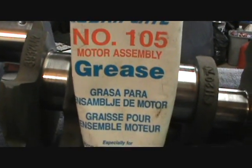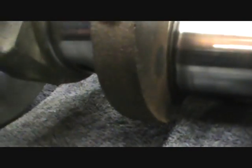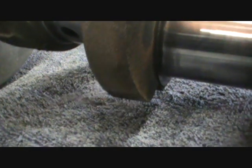But anyway, and I know I'll probably catch hell, but right here is what I use to put my motors together. I use them on the pistons, I use them on the mains, I use them on the camshaft. I started doing that and using that lubricant, white lithium grease, or assembly grease, whatever they call it. And I stopped having troubles. I had one shop say, "Oh, that stuff plugs up the filter." I said, "No, it don't. As soon as the oil gets warm, it melts and it turns into an additive with the oil." I've had motors where I've ran my race motors, tore them down for a refresh, washed the bearings and put the bearings right back in and ran them again.